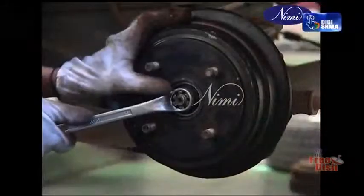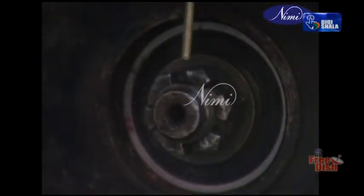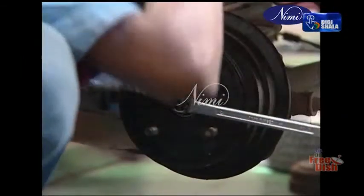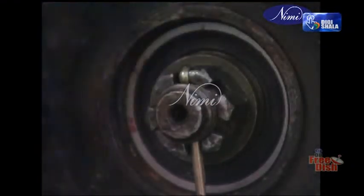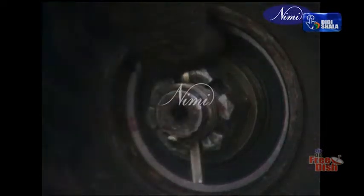Split pin. Tighten the nut at the specified torque. Check the bolt's hole and nut's slot alignment. If not aligned, line up the hole by tightening the nut slightly. Insert a new suitable split pin in the slot and hole. Drive the split pin fully inside. Spread open the sides of the split pin and bend it on the nut.